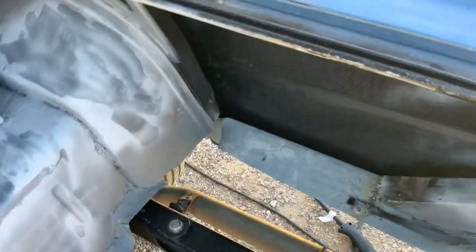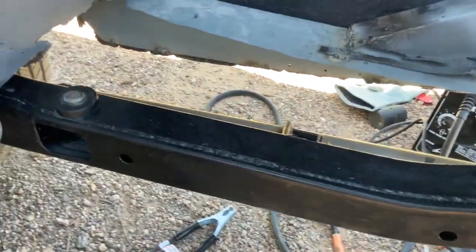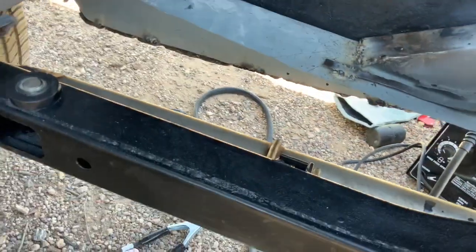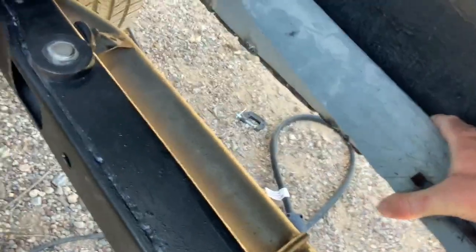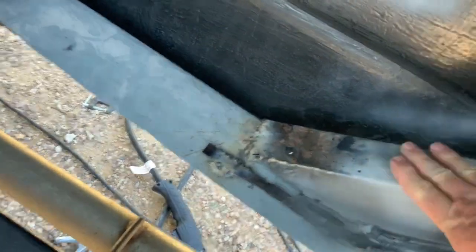So I got the drop off in. We got it in a few spots on the bottom. You have to be really careful there because that's thin and rusty metal in spots, and you'll just blow right through it with your welder. But it's solidly in there. I got it back in there and against this post and stuff, so it's in there real solid now.